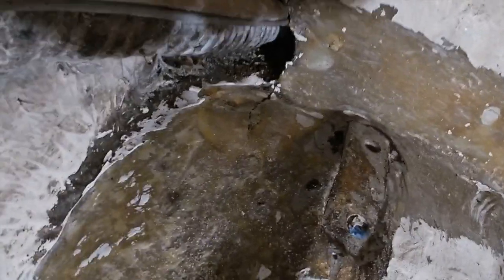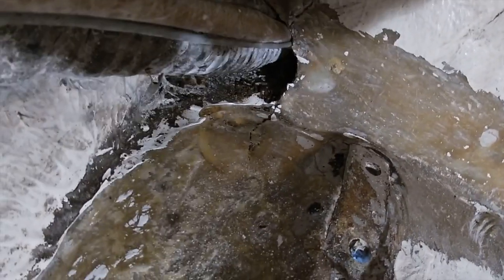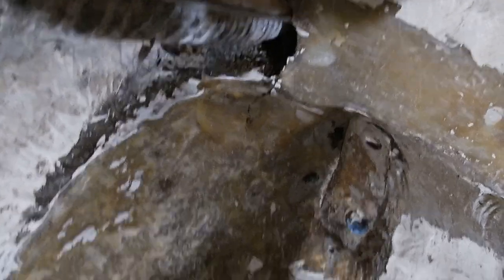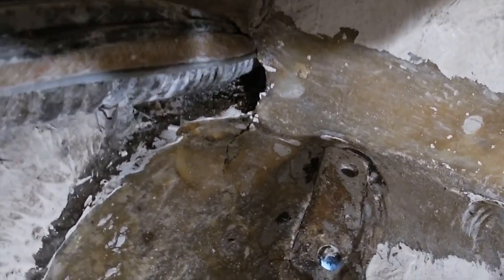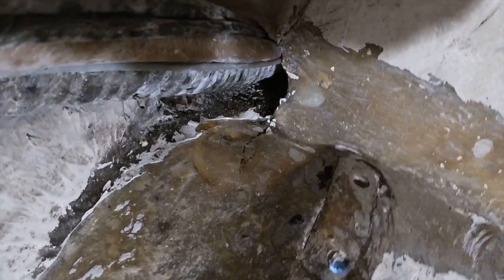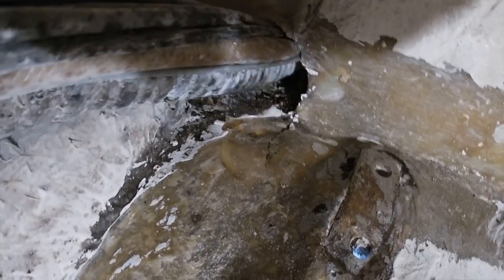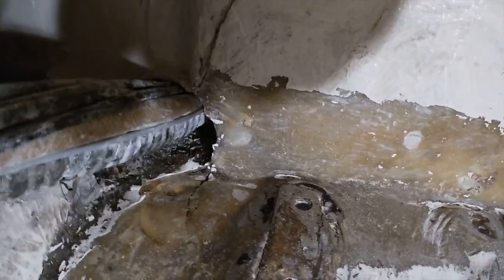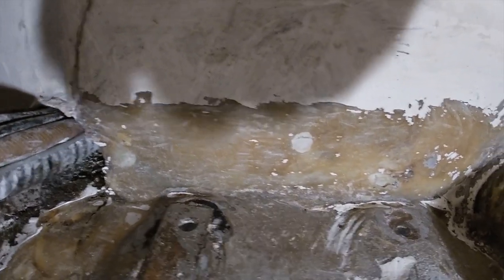Look right there. You see that crack? That was where the crack ran the other way. So that crack is all ground out, and I'm gonna fix that. But that's not that big a deal. It's just a little bitty crack that sits next to the strut. I'm gonna put about 8 layers of fiberglass there too, and that'll strengthen all that up. And plus we put all that strength on the other side. There's never gonna be any more stress on this.